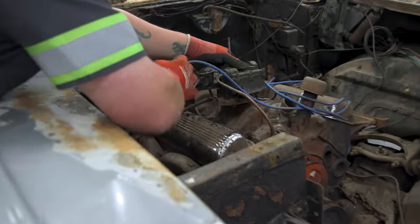This LS is going to require lots of fuel. I don't know the length of my fuel line yet, so I'm just going to be putting two ends on, put it up on top, tighten these up, and cut it to length. The nice thing about these fuel line kits from Summit is these are push-in style barbs and they do not come out - literally you just push them in and the hose does not come off. We've got to put the power and ground for the sending unit. So if you have a ground and then you have a signal, what would you consider the signal?